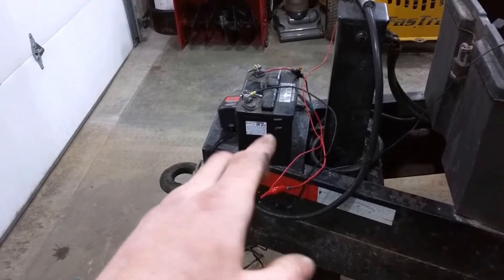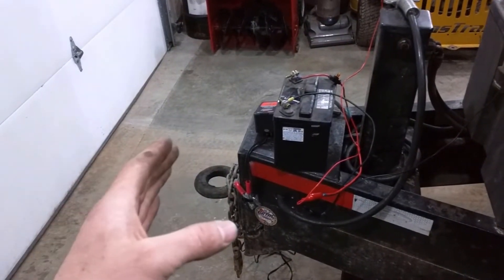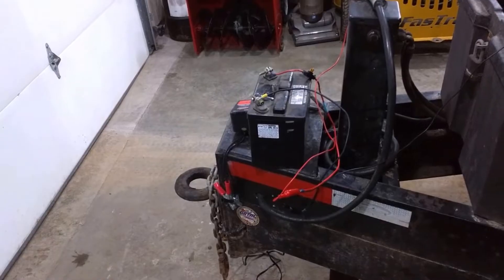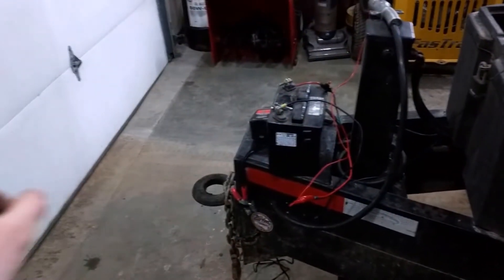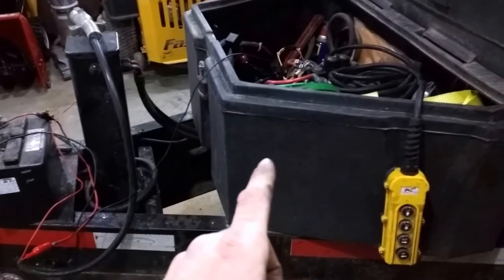This battery here is to simulate being hooked up to a truck. Most new trucks have 12 volts to the back, which is good — that keeps your battery charged. They usually have a 20 amp fuse in there. The problem is that when you operate the hoist under heavy load, you're going to draw way more than 20 amps. It'll pop the fuse in your truck, you won't know it, and your battery will be dead at the end of the week.